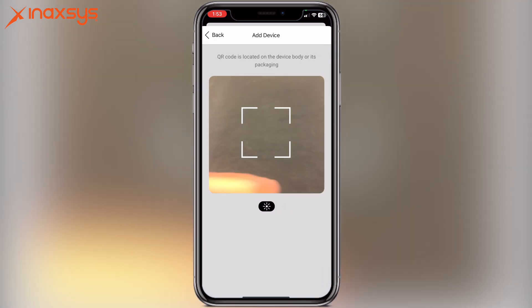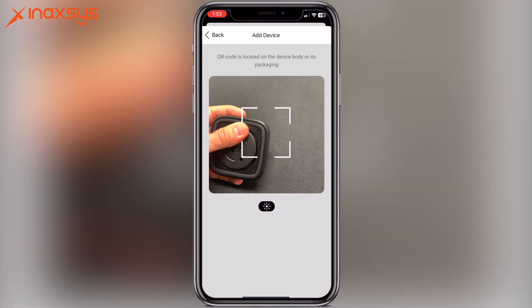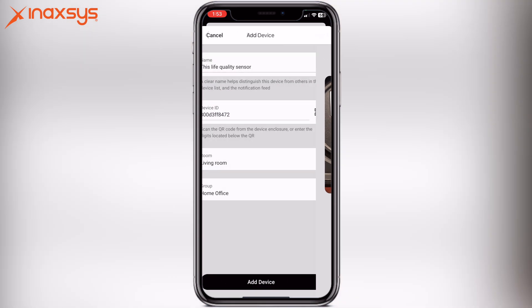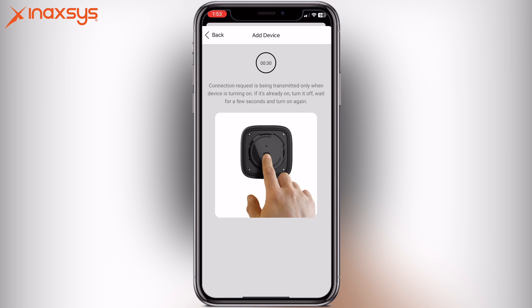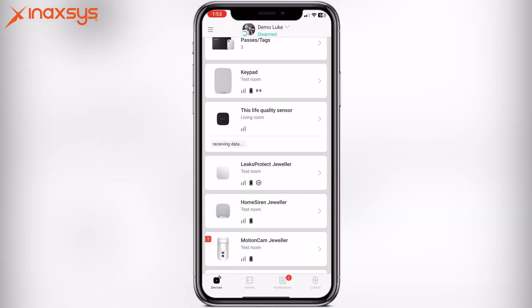I then click on the QR code and on the back of the Life Quality Sensor there's a little piece which allows it to attach to the wall. You take that off and you learn it in via the QR code. Once you scan the QR code, it's going to ask you which partition you want to add it to. I'm going to add it to the living room and I simply add the device. It then asks me to turn on the device, so I push the power button on the back, just as the image is showing. Once I turn the power on, it sees it and says OK.